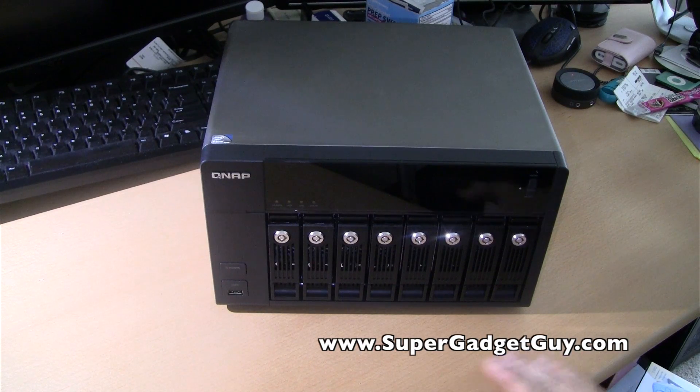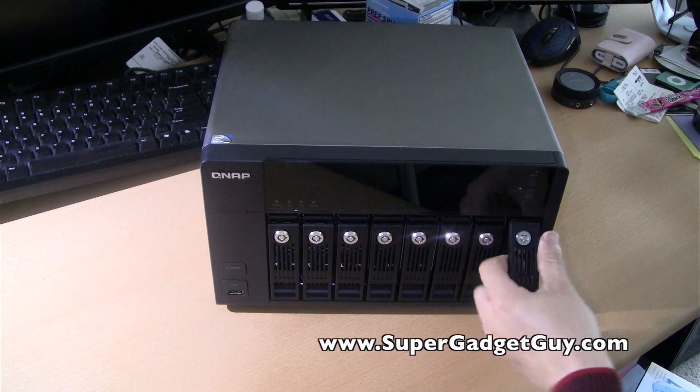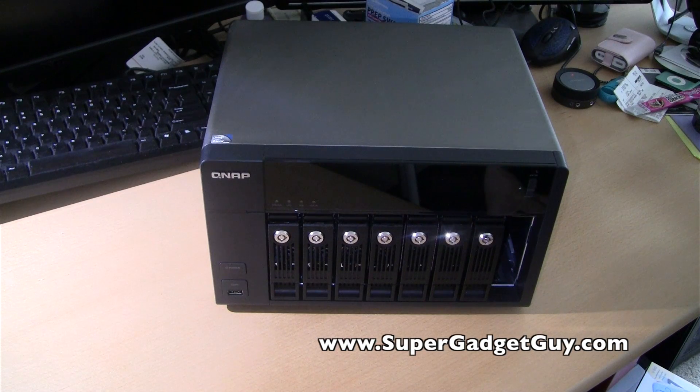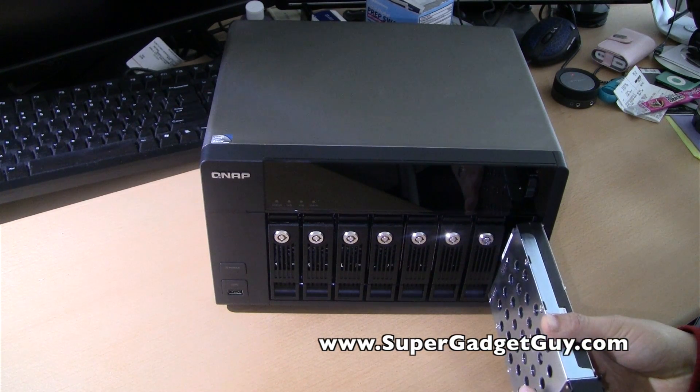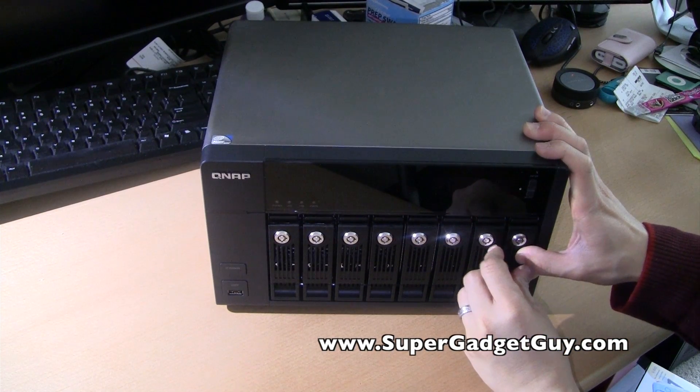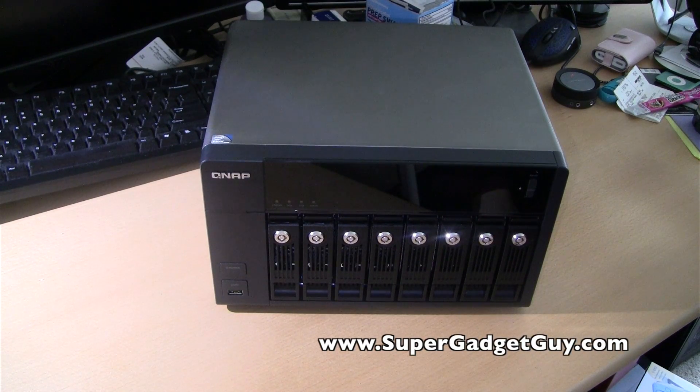The unit is currently powered off because the power cable is not long enough. Overall, the hard drive tray has really smooth operation, and compared to my AL-9 Pro, the processor switched from a Core 2 Duo 2.8 GHz to an Intel Atom processor. Overall power consumption has gone down on the processor front without sacrificing too much CPU performance, due to a change from dual core to dual core with hyper-threading — so you have four threads. I didn't notice much difference in using it; the interface is pretty slick and they run the same software.